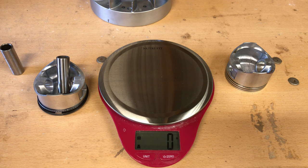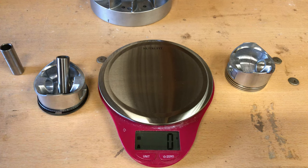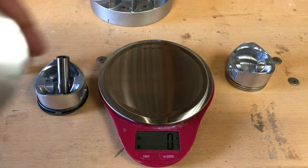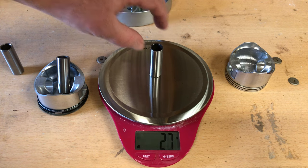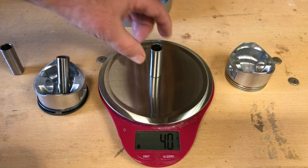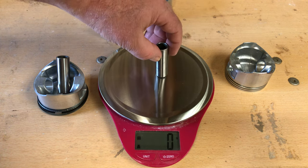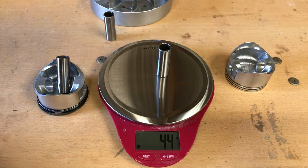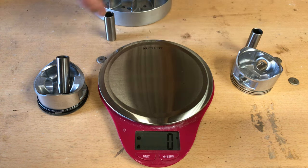The main thing I wanted to compare was the difference between this 224 Predator piston on the right and the Wildcat flat top piston I've been using on some of these builds. The Wildcat piston with the EC billet rod — that billet rod is 3 inches, 353 thousandths long, so it's 50 thousandths longer than stock. That puts the piston up the hole further. The Wildcat wrist pin is 40 grams — that's a 709 thousandths wrist pin — versus the 224 which is around 44, so about 4 or 5 grams lighter with the Wildcat.